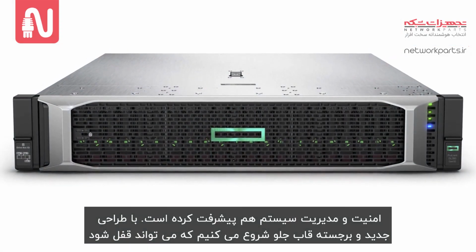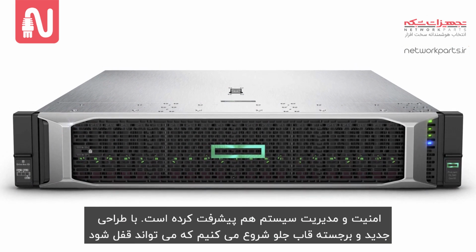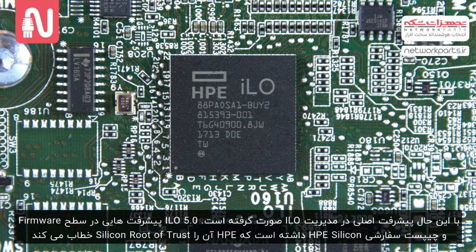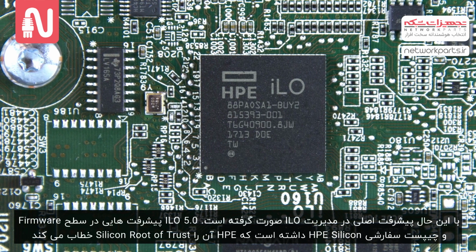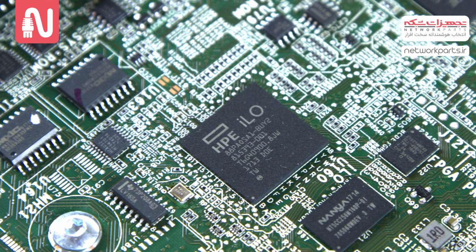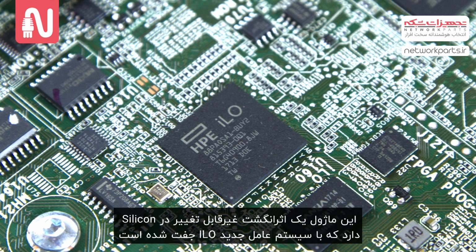Security and management of the system have also been enhanced, starting with a striking new design for the front bezel, which can be locked, and the typical intrusion sensors. However, the real improvement is the integrated lights-out management module. iLO 5.0 offers improvements at the firmware level, and a new custom HPE silicon chip provides what HPE calls the silicon root of trust. The module has an immutable fingerprint in the silicon paired with new iLO firmware.